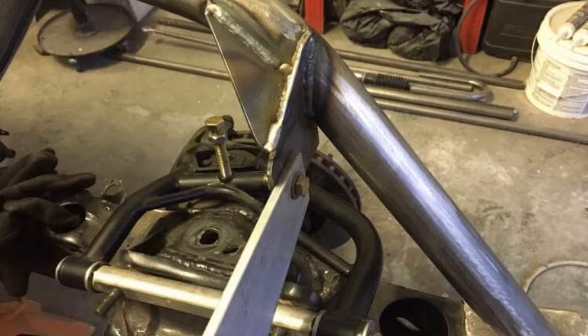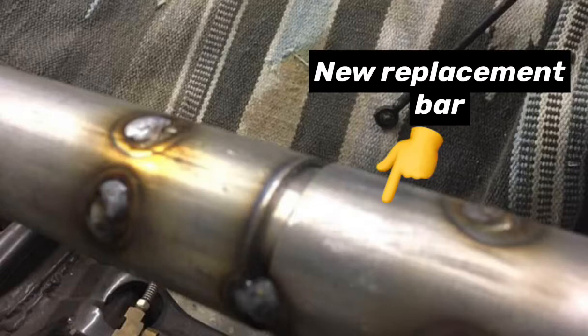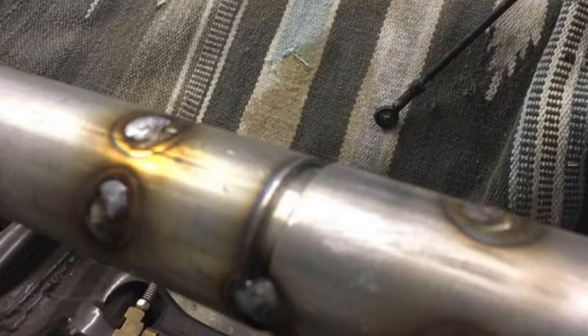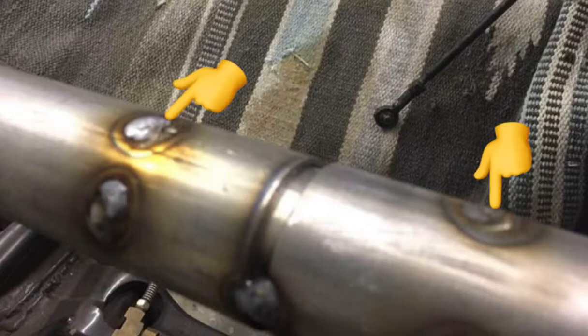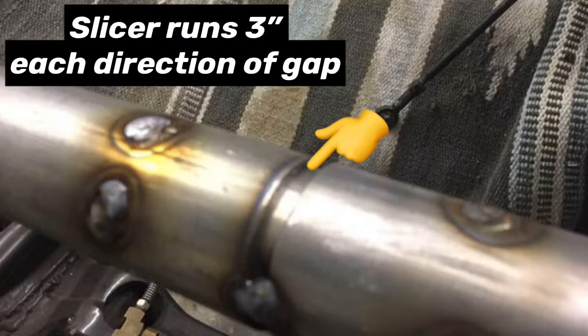Here I'm showing you where I've actually had to cut the front down bar and add in a totally different bar — this is what you have to do to splice a roll cage, and it's actually to code per the rulebook specifications. You'll notice a gap between the old bar on the left and the new bar welded in on the right. That gap is filled with weld. There are holes drilled through the first pipe with an insert that goes between the two pipes — basically a splicer — and those drilled holes are then welded, which welds to that insert.